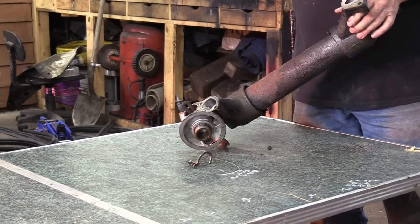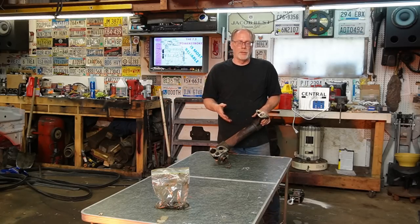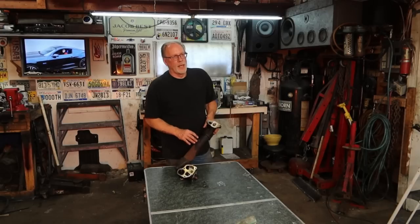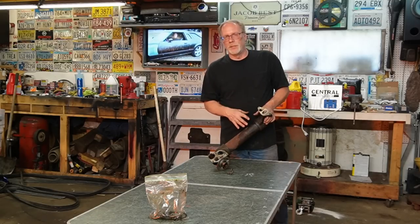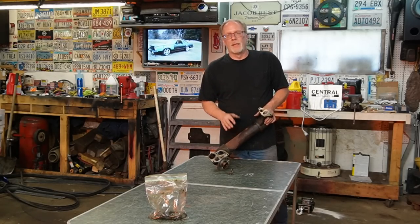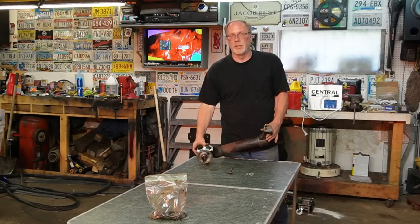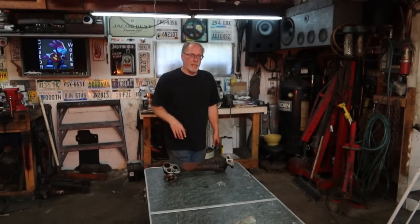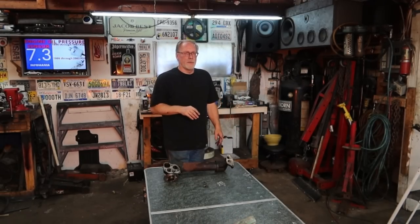And if you don't change your cooling system fluid enough, and you don't change your oil enough, that is going to get all blocked up inside, and your oil is not going to flow properly. The coolant is not going to cool the oil properly. It can even bypass it, and that is a real issue, especially for some people who use some really cheap filters, like STP filters. Bad idea. What you put in is what you get back out of it.